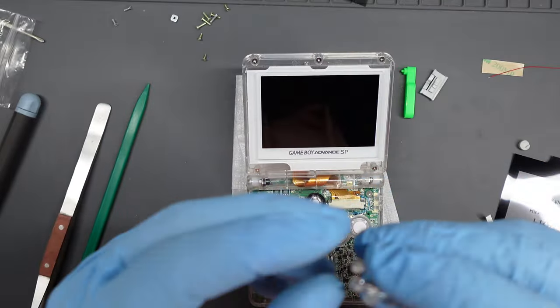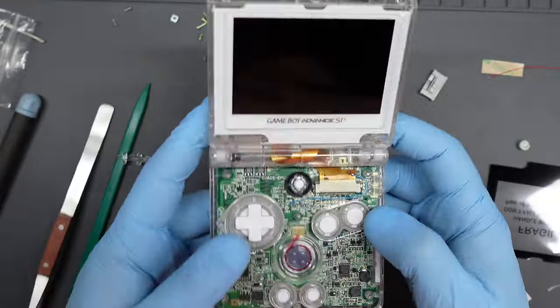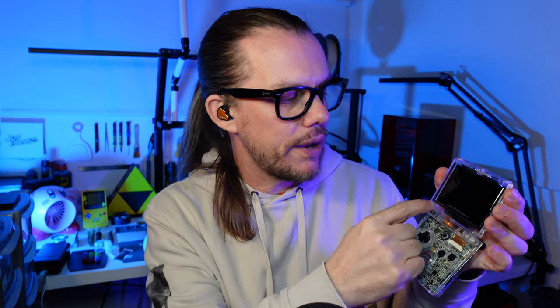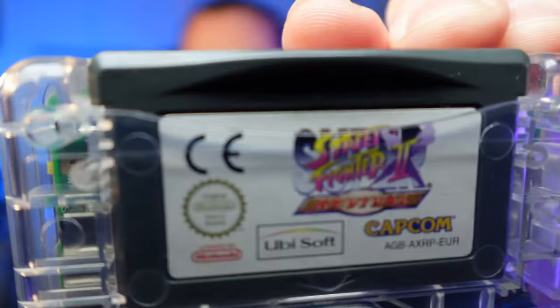For the finishing touches, the kit comes with tiny gel circles that push into the screw holes on the screen surround. They're not all the same: three flat disc-type ones and two slightly thicker ones. The thicker ones go in the two top corners so the two shell halves don't directly contact each other when closed. The other three go left, right at the bottom, and top center. They're not self-adhesive but have a gel texture so they stay in position — and being completely clear, they look awesome. Finally the Nintendo logo badge goes into a recess on top of the shell. I decided to leave off the back sticker so you can see the cartridge artwork through the clear shell.